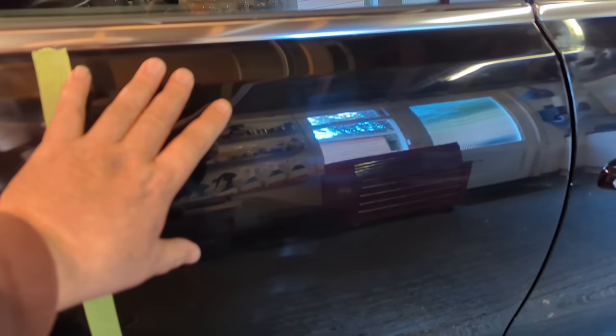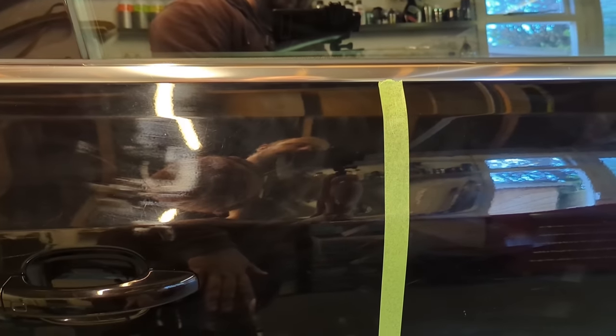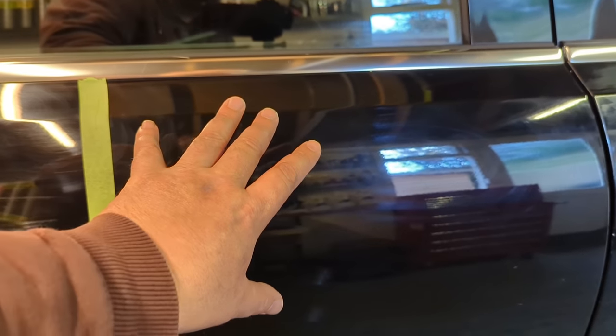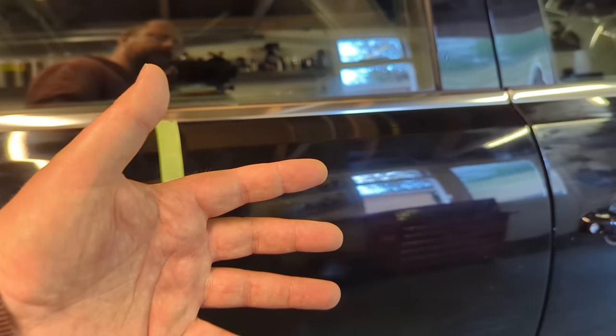Some of your results are less permanent because of the filling effect. If you cover this in a resin — if you cover it in olive oil — you'd lose these swirls for a little bit until you washed it. A similar thing with some of these fillers: they'll sit inside the swirls and hide them, and over time as you wash the car they'll erode. You will see some of the work is not permanent. That's the downside of polishing by hand.